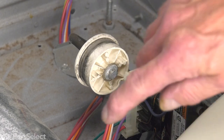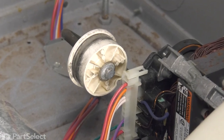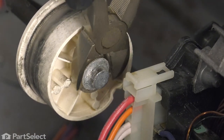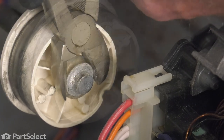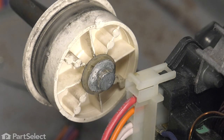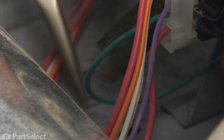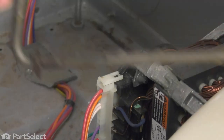With the drum out of the way, we have access to that idler pulley. There's a cap nut that holds that pulley onto that shaft — after it's pressed into place it's on there quite tight, so we'll need to pry that off. Using either a flat blade screwdriver or a pair of channel locks, go in between that cap nut and the pulley and try to pry that off. If you have difficulty prying it off with the idler arm in place, you can remove that whole assembly. Simply disconnect the spring from the base — just grab the end of it with a pair of needle nose pliers and pull it out of the slot. Then you can pull that bracket straight back and lift the assembly out.